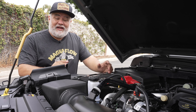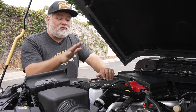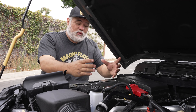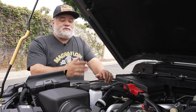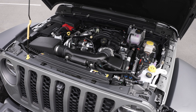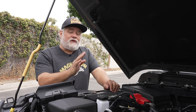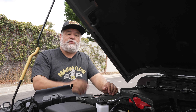Looking in the engine compartment and understanding this whole partial hybrid e-torque system, there's a lot different in here than I'm used to seeing on the 3.6. Doing some research, one of the first things I found out is there are three batteries in this vehicle. The primary battery, right on top, does everything you'd expect from engine starting and normal operation. They also stuck a smaller motorcycle battery below it because this has the gas-saving start-stop feature, and that secondary battery helps take the load off the main battery. With the e-torque, there's a third battery — a 48-volt battery set down under the vehicle that just runs that e-torque motor. It's there to assist with the low-end torque demand originally developed for the four-cylinder, but on the six-cylinder it gives you a nice kick in the pants for acceleration and also helps with the start-stop function so you don't notice that delay anymore, with the electric motor assisting the gas motor under those conditions.